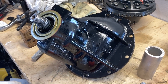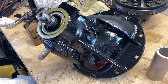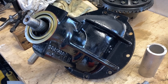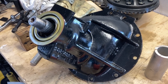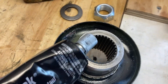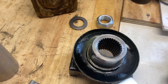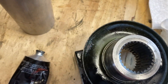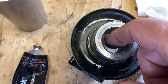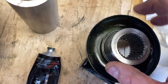I've got the pinion end mounted and shimmed, the old bearing is in, and a new seal. I've got to lube the front of the seal, and then some RTV around the splines of the pinion yoke. This here is pretty much the whole point of this video - sealing the splines on your pinion yoke.